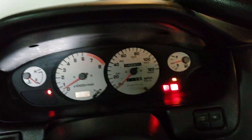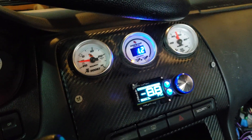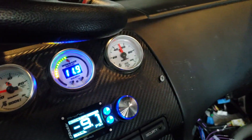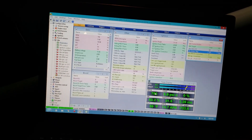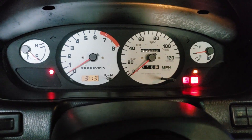Okay, that's pretty good for a first try. Let's see what the wideband says when it finally gets warmed up. Alright, 11s warming up. Oil pressure could be better, but I believe we are idling at 800 — I think that's pretty close.